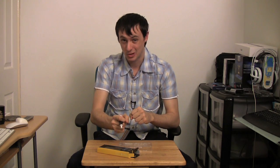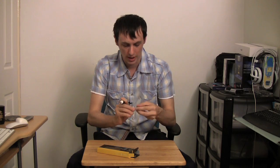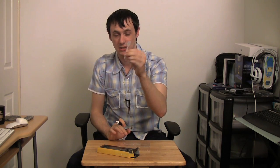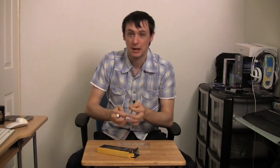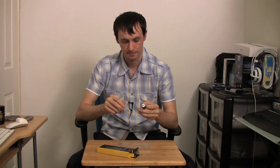You can then place the CPU cooler back on top, just give it a little wiggle around so it gets nicely spread out, then lock your CPU cooler down. Or you can use something like this included tool, where you can just squeeze some compound on and spread it all over the CPU if you wish. I have known people that put it onto the heat sink first — personally, that is the wrong way to do it. Always apply it onto your CPU first.